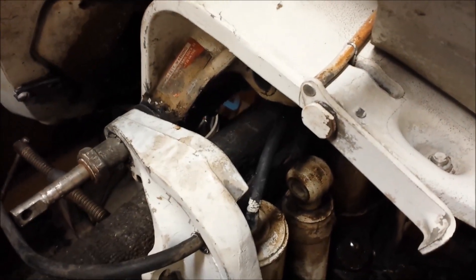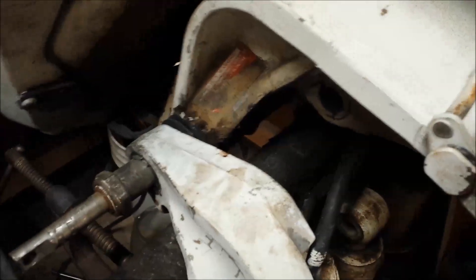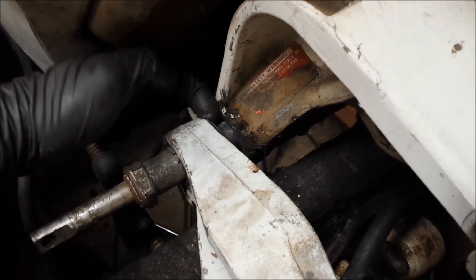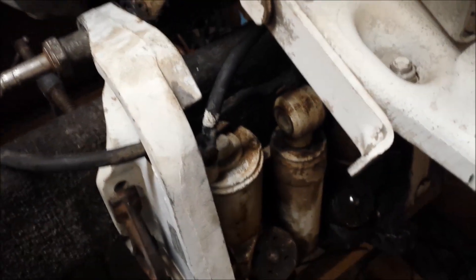These units are supposed to be able to fit out inside of there. That side has a notch, but this side doesn't have it, and it was giving me trouble. Luckily, the entire midsection on this engine is falling apart — that's why you see this stuck steering cable and this broken tilt tube. I hammered it out just a little bit, about half an inch or so, and that should give me enough room to get it out of there.